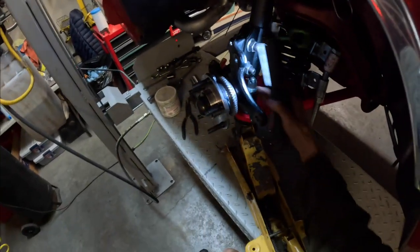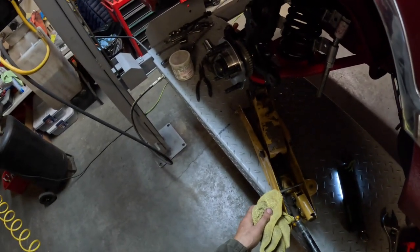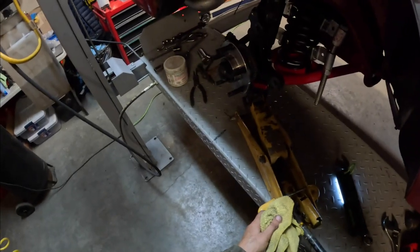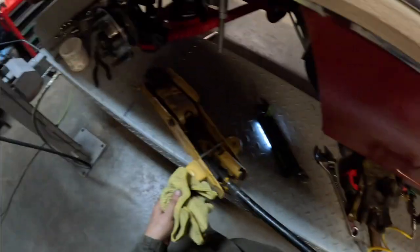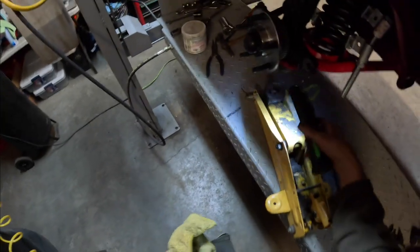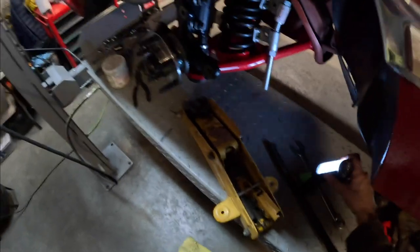Again, we've got our spacer in there — so that's good. Yeah, that was fun guys. In a previous scene this thing exploded on me, sheared off the saddle — a lot of pressure there. We'll go down real slow, should be okay. We're good — I still got the spring compressors in there. So that actually worked out: by accident, shearing off this saddle, this could go lower so I could get the spring in there easier. Kind of weird how stuff goes, but that's what happens.